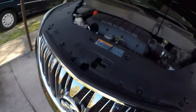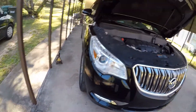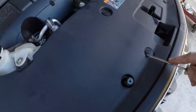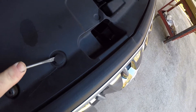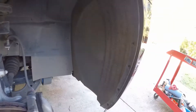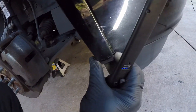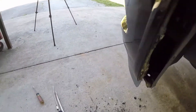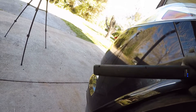What you're going to want to do first is take this off here. You're just going to pop these up and pull these up. You're going to take this off — I'm not going to lie to you, it's going to be a pain in the butt. You're going to end up taking this trim off here. This trim right here pushes in, I'm going to pop it out. You get your T20 and undo this side all the way up to here, pull it out, then just pull your trim back out like this — it just clips in.